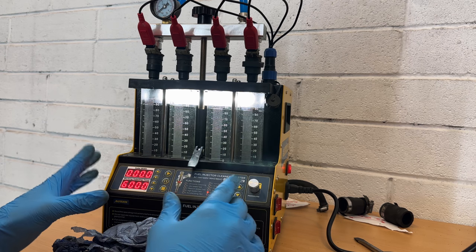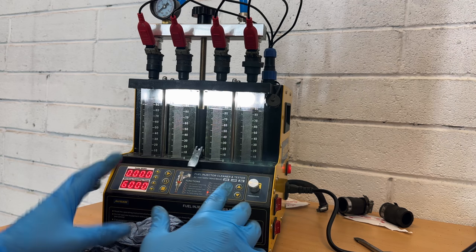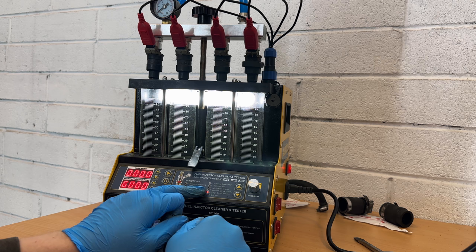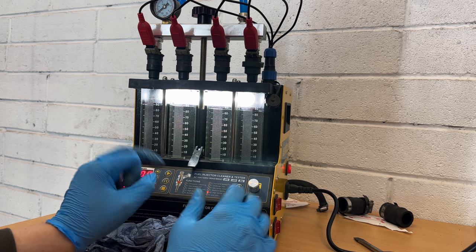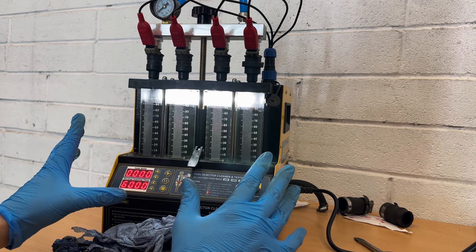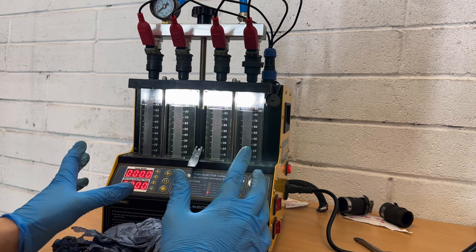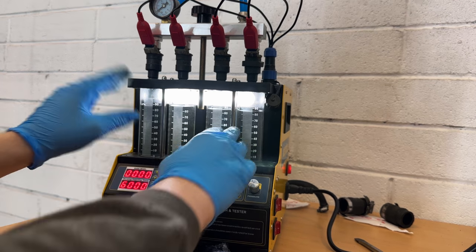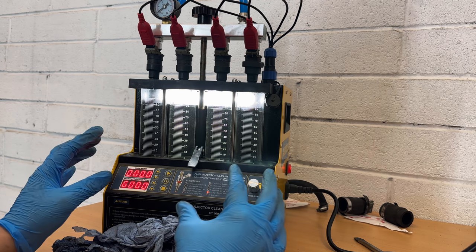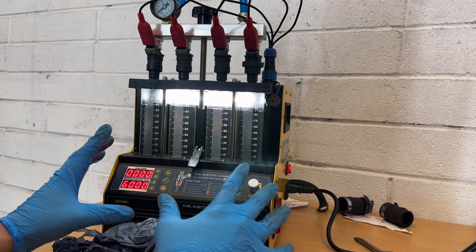And there we have it - I'm so happy with how this has turned out because all of these are around the 90 mark. All the other injectors were around the 90 mark on high spray volume. I've gone through the idle spray, the medium spray, the idle speed test, the high speed test, accelerating tests - and every single time the four in the rail are matching up. The ones that come in afterwards doing the same tests are also at extremely similar levels. So I think the injectors are absolutely fine - I think they're working perfectly. Hopefully we'll get this back in the rail, get everything back together, and the car will be running sweet.